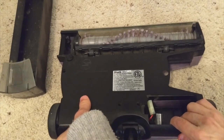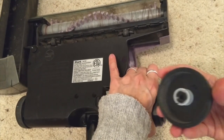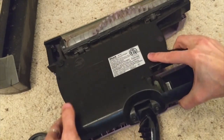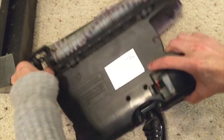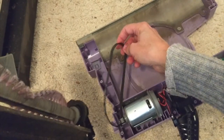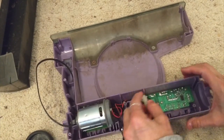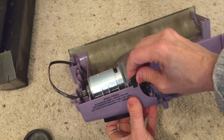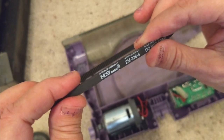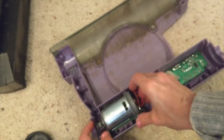As the screws are out, you basically just pry the two pieces apart. Open the case slightly and pop these wheels out. And you can see there's our belt — let me remove it from the roller. It's extremely basic. The handle just pops off. There's the battery connector and the charger connector, which just sits right back in there. The belt number is 2M-336-5, and the motor is just like a little project motor.